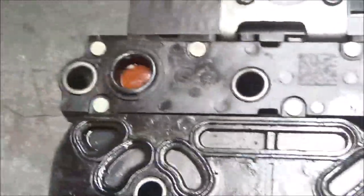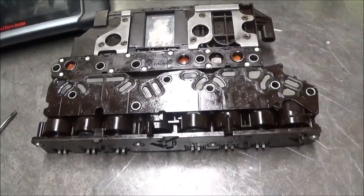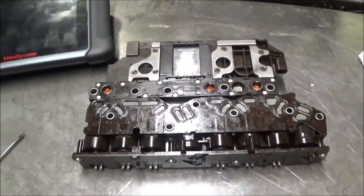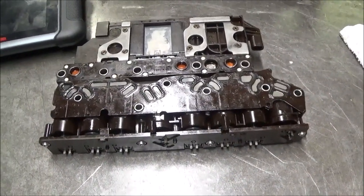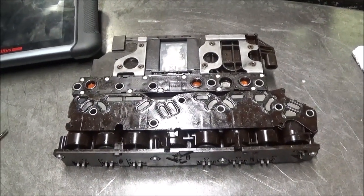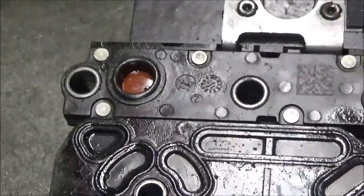So for those codes you saw, the problem that caused that delay and the shifting issues were the pressure switches going bad. You can fix this by simply changing the TCM, but if you do that — which is this thing right here, it has all the shift solenoids on it — you'll pay eight to nine hundred dollars for a new one, then you've got to get it reprogrammed. If that's the only problem you're having, the only thing you need to do is replace those switches.